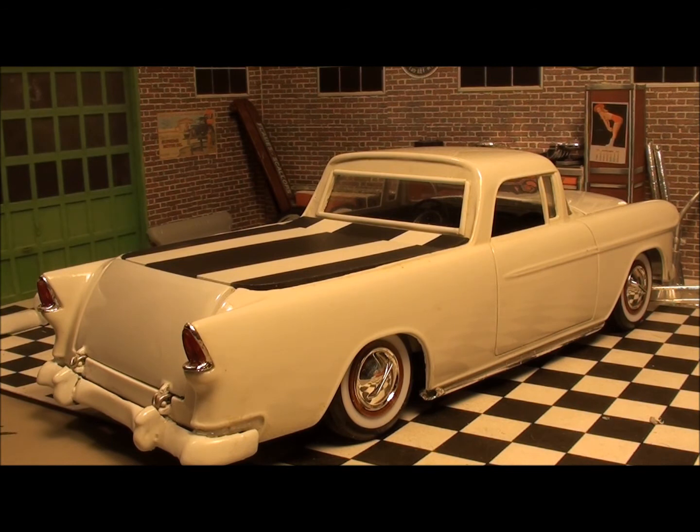I might mention too, I did look at how the paint was coming off my 50 truck. Pretty good. I've got the cab in one type of solution, and I've got the fenders and the bed and etcetera in the other. I've got it in the purple power, and it's actually doing a better job than what I've got the cab in. So when I get the bed and fenders and that out of the purple power, it's almost all off. I'll probably have to take the cab out of the one solution and put it in the purple power.